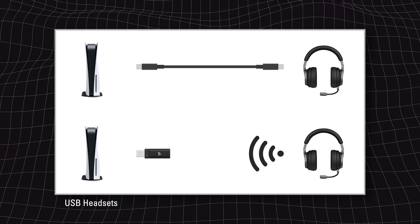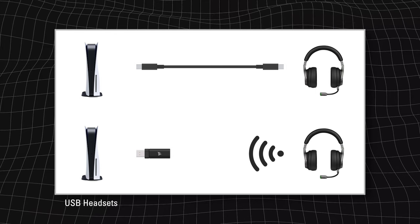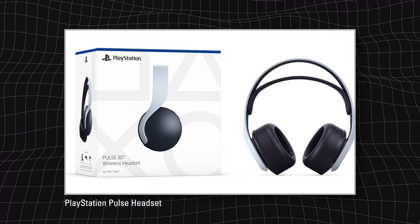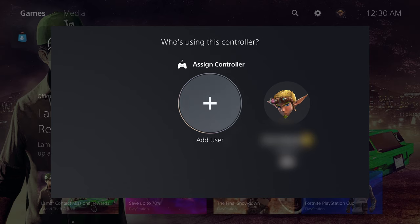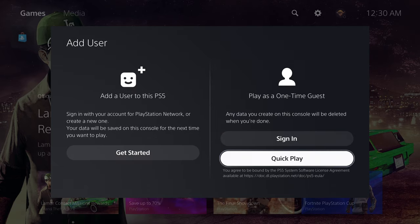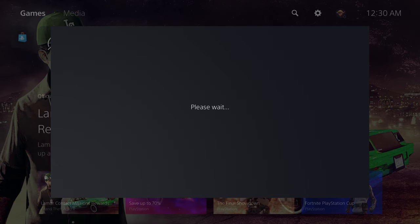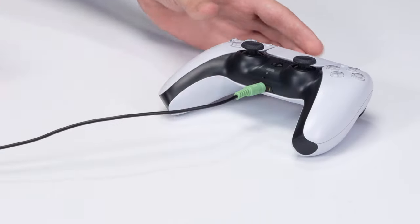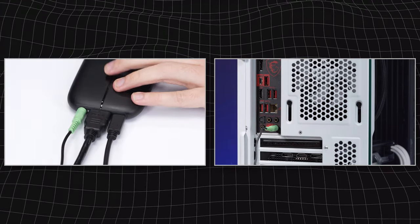First, let's start with USB headsets. This can be a headset that terminates in a USB plug, or a wireless headset with a USB receiver. The PS5 Pulse headset is an example of this type. For these headsets there's only one workaround: the only way to capture audio while using a USB headset connected to your PS5 is if you have a second PS5 controller connected to the console, either wirelessly or wired, and connect a 3.5mm aux cord from that second controller's headset port to the 3.5mm line-in of your capture card or computer.